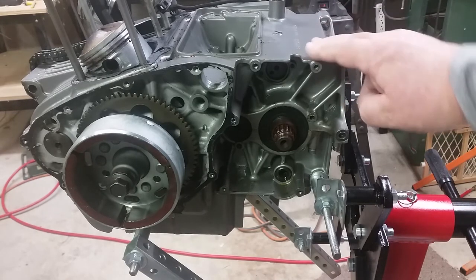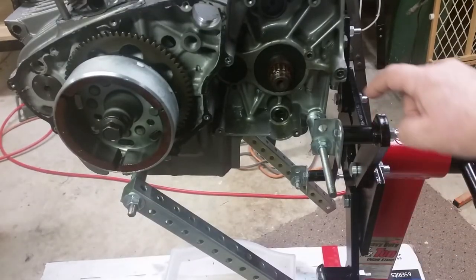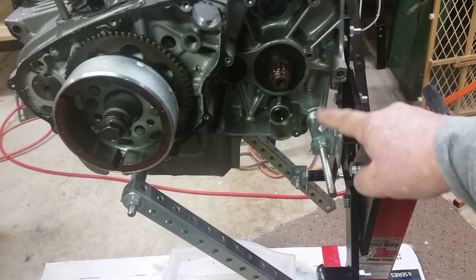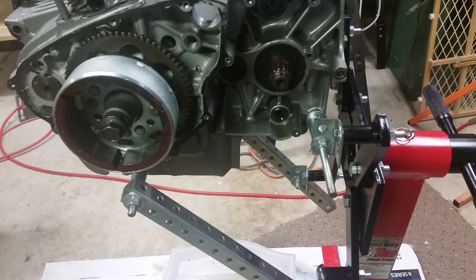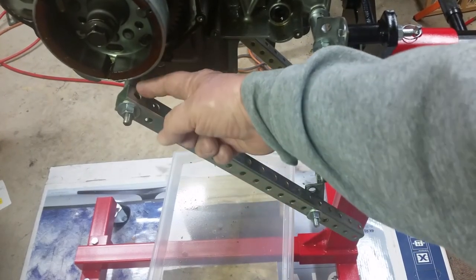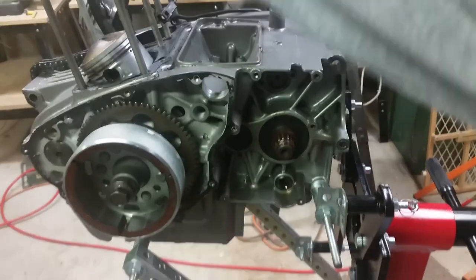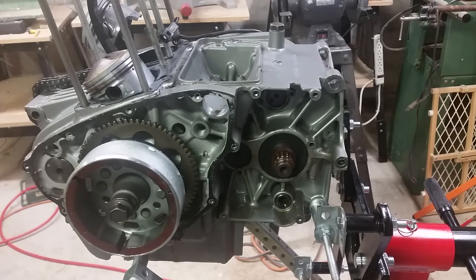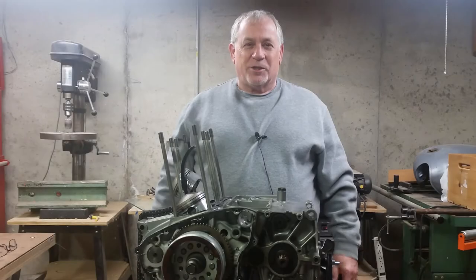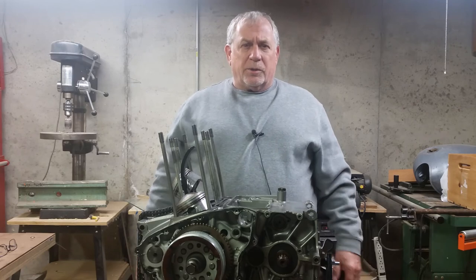Here's the engine mounted with just the bottom half of the case. I did this so I could split the case — which splits right here — and lift off the top. The way I did this was I cut some pieces of conduit to act as spacers, used these brackets that I cut before, got a 3/8 inch threaded rod, and then used square tubing picked up at Home Depot. Using the conduit as spacers and the 3/8 inch rod, it's mounted on the brackets and the whole thing is very solid. I'll be able to flip this around, take the screws out from the bottom, and take the top half of the case off. So that's it — using a Harbor Freight engine stand as a motorcycle engine stand. I hope this helps you as much as it will me. Until next time, ride safe.